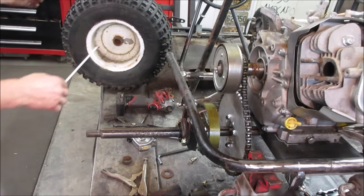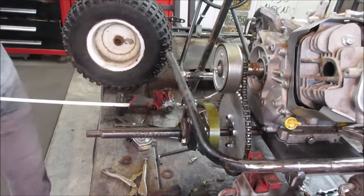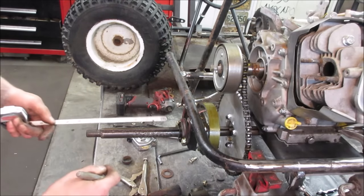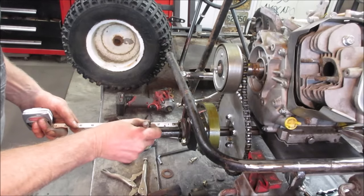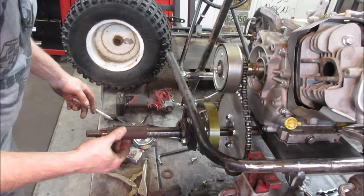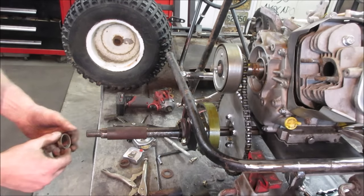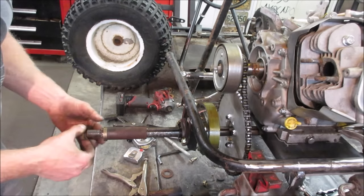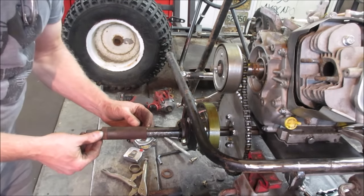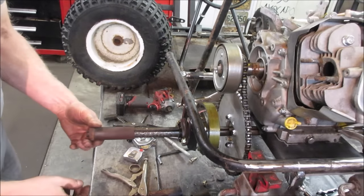And we got to subtract the depth of the wheel, the rim, which is going to be right at 3 inches. So marker at 3, and we just make up the rest. So the wheel's going to come to there, and we have to stack up some parts to make it get to that last little bit. I think there's a couple of small ones. You got that one? Actually, will that one make it? Ooh, that's looking close. It might be. We might need a washer. Does that fit, or is that the inside? Yeah, let's go find a washer.